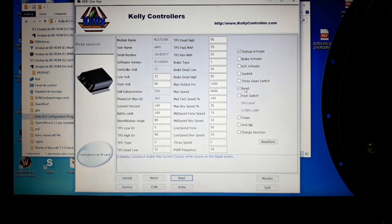The boost function allows you to use a switch to instantly go from any throttle position to top speed — like a turbo boost. It's useful when using the three-speed option: if you're driving at low speed but need an instant boost without changing gear, you just press the boost switch to, for example, overtake a vehicle.